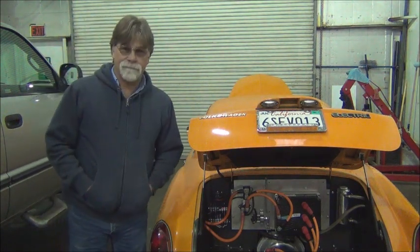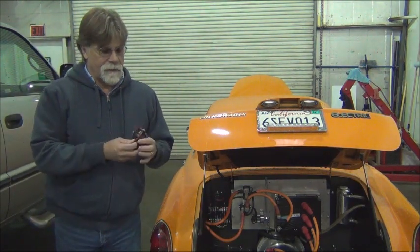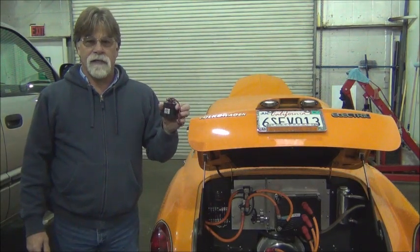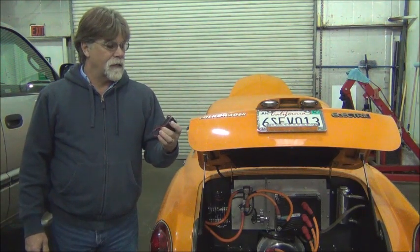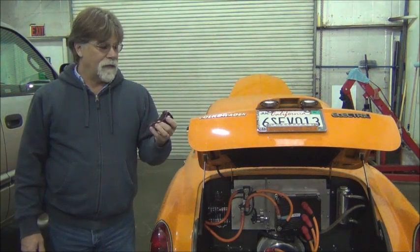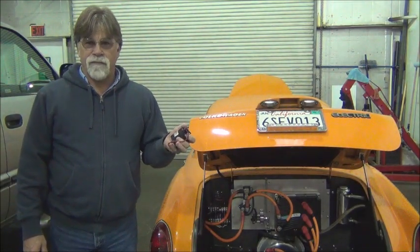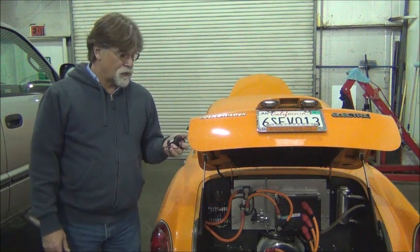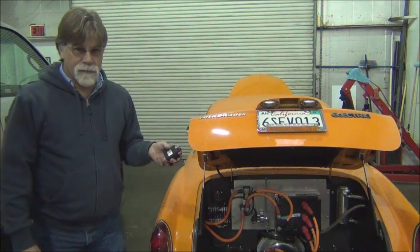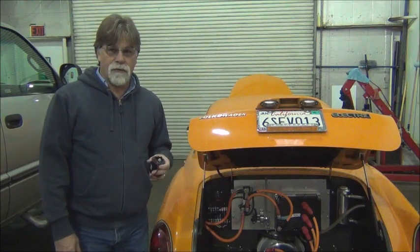In the meantime, I ordered a replacement, and this is what we're looking at. This is a 12 to 24 volt DC coil on this contactor, and it's rated — I believe — 500 amps continuous. The most we'll ever draw through this is maybe 512 amps for a short period of time, and this is what high-performance vehicle systems send when you purchase the AC51 with the Curtis 1239 controller.